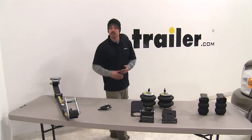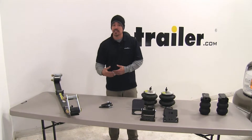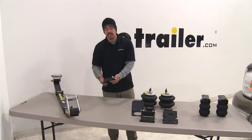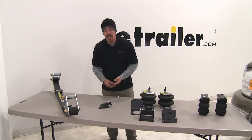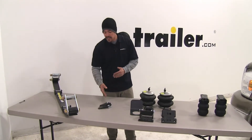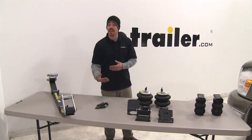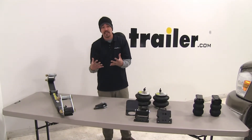For our overload pads, it's a very simple installation, but it may be a little time-consuming and strenuous. It's a very simple design and it's not going to take up a lot of space on your truck. We're not going to have to run any air lines or remove anything factory from the truck, though it is a little strenuous to get installed. It's going to give us that support by applying our overload springs immediately rather than waiting for our leaf springs to flex.